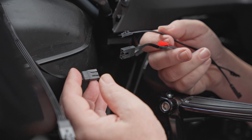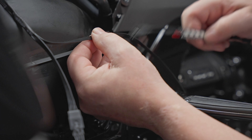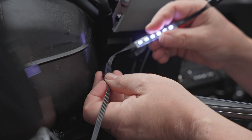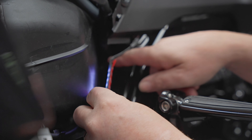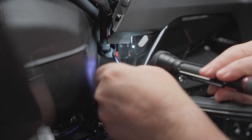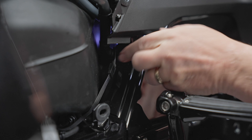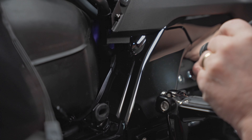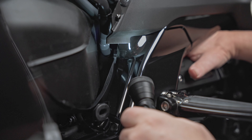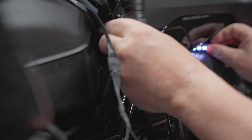Now we're going to run the leads to the engine — we're going to need an 8-inch right here. Plug that into this Y that we put on before, then attach a light. Have the light on at this point — it'll be very helpful. We're going to go in through here and out on the other side. It's a little tricky because you want to go above this hose right here. Go above that and around on the inside. Just feed it through, then reach in and pull it gently, and it'll come through over to the other side.